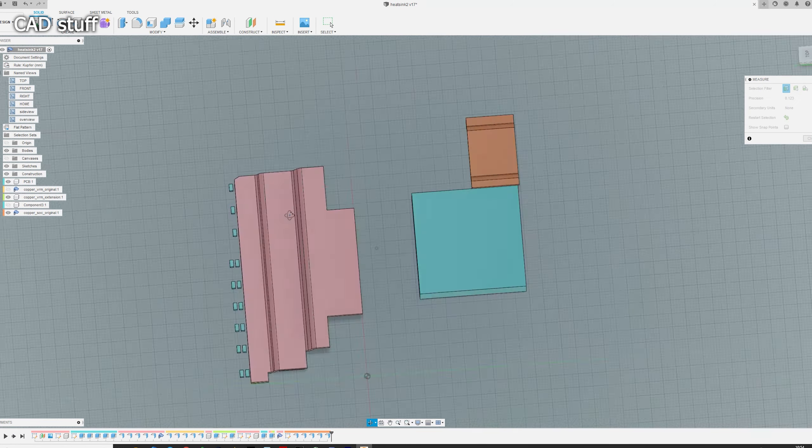After finishing my sheet metal design I created a press die in Fusion 360 and printed two iterations in PLA on my 3D printer. The plan was to use a bench vise to press both blocks together, which forced the copper sheet into the given shape. With some force and after two iterations it turned out great. The curves are a bit less pronounced than planned in CAD but the new coldplate is close enough to my reference 3D print and the overall dimensions are fine.